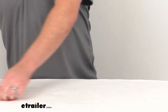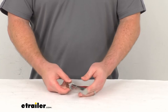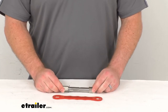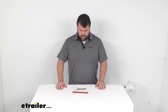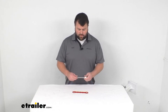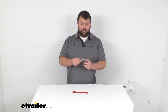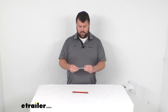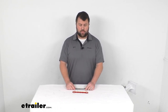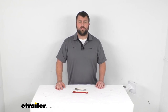It is going to be the exact same for your two and a half inch pin as it is for that two inch pin. The same sturdy steel construction, so it is going to hold up really well for you. And it is made here in the USA, so you can trust it's made to high quality standards. So if you are looking for an anti-rattle pin for your solid shank — and I want to stress the importance of that: it does have to be a solid shank, otherwise if it's hollow that's not going to expand against that pin opening. So any of your solid shank Gen Y accessories, this will do a good job fitting into your two and a half inch receiver on your tow vehicle or your stacked receivers on your ball mount.